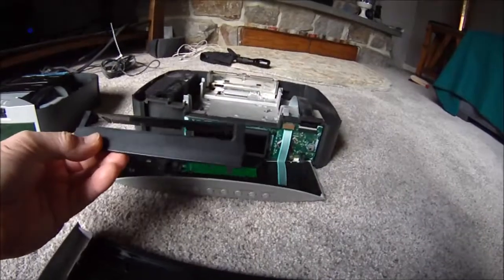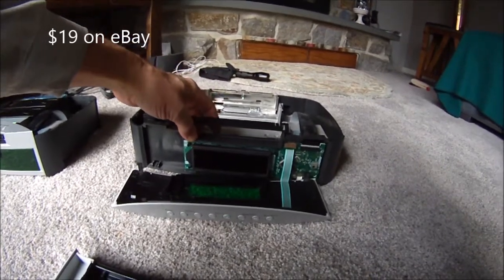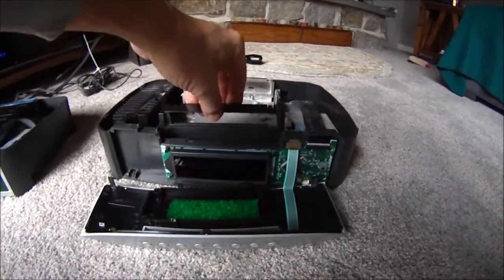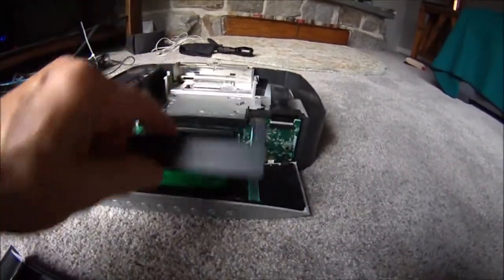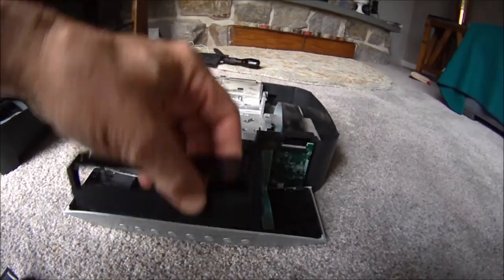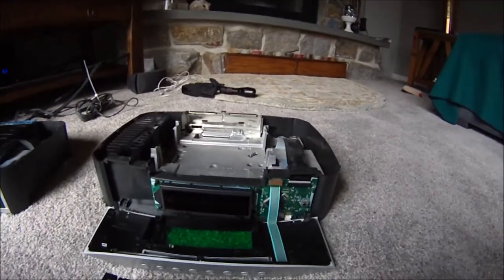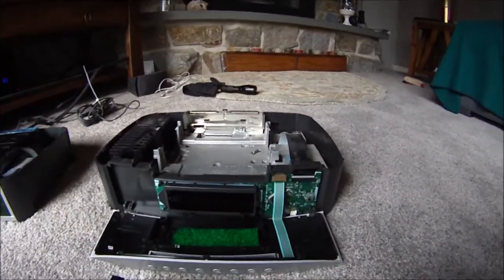This is another one I bought for parts. You can see this is the front that fits behind the DVD player itself, which is made by Toshiba. This unit was slightly different than the one in mine — even though both are made by Toshiba for Bose, they were a different model number and not interchangeable. On the front of the DVD player, once you get it out, you can see there's a tiny little hole where you can put a pin through, which releases the mechanism inside and allows the tray to move so the door will open — without breaking it any further.